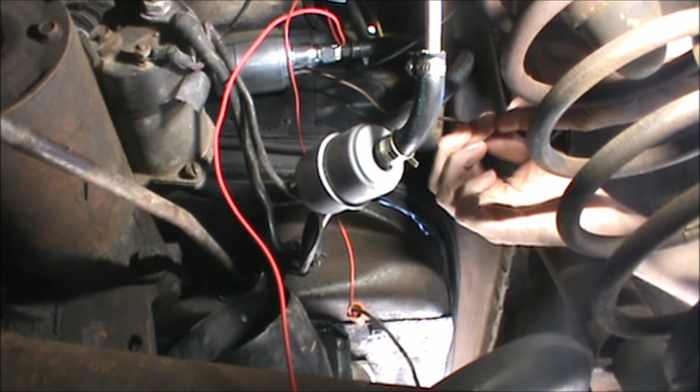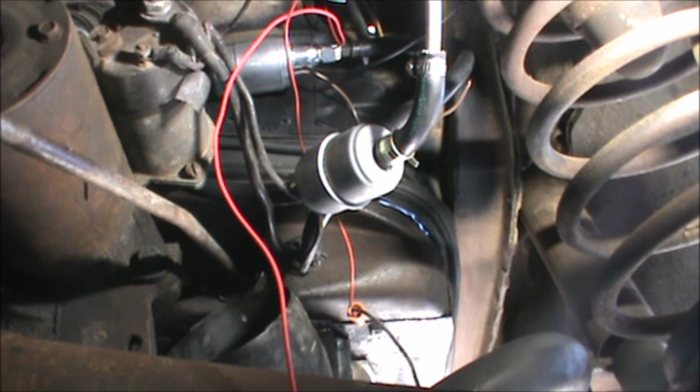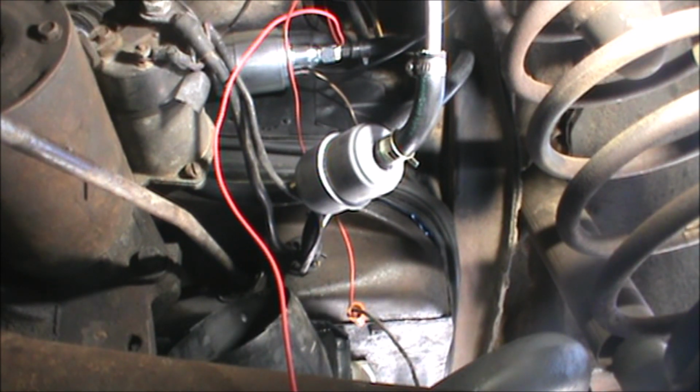Okay. This brown wire here is positive. All right, the lavender needs to connect to that. Crimp connectors here. Need to strip a little of that off. And that lavender wire, which I explained in a previous video, is in a loop that you cut, and then you route one end to a non-switched hot, the positive terminal on the battery, or a terminal on the starter motor. So on the way, I am going to go with the former and not the latter.